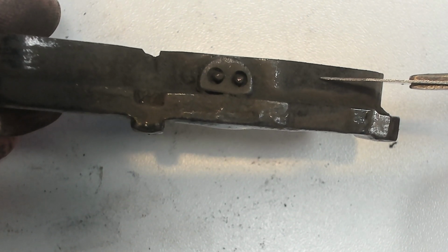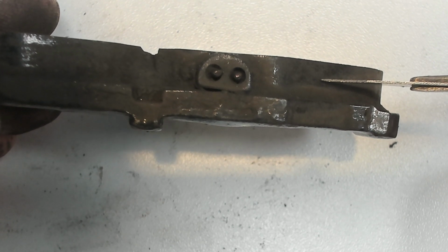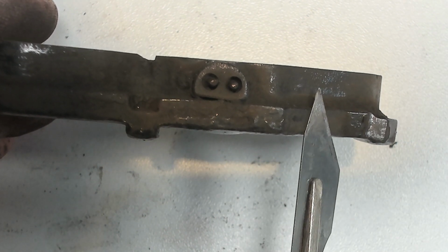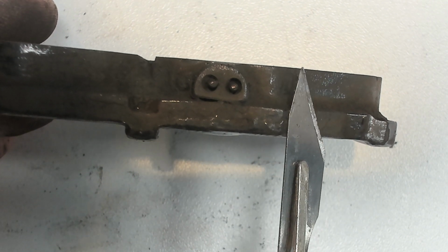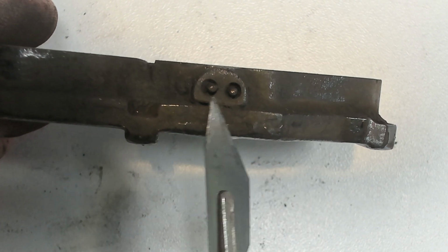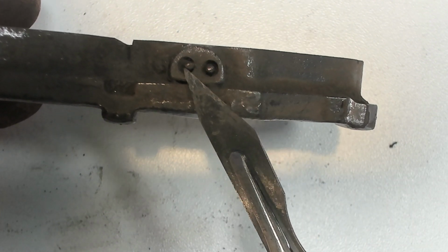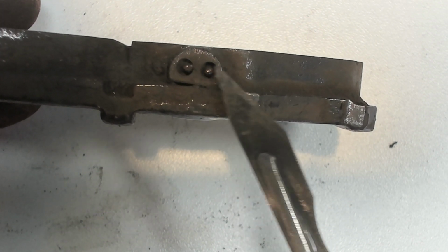But I'm curious why. I can understand some cars, I believe, have a low wear indicator. As the pad wears down like this, it makes contact with a probe, which puts a light on the dashboard like, your brake pads need renewing. But I would have thought that would have been a probe in that orientation, like a paper clip, if you can imagine. So as the pad wears down here, it comes into contact with the probe there and there. But this is sticking out the side. So as the pad wears down, I don't know, it just seems weird.